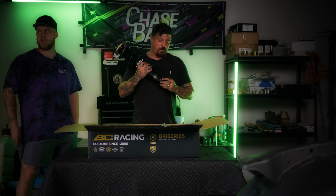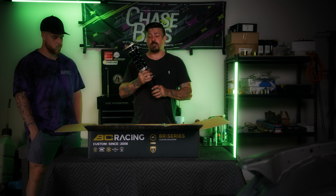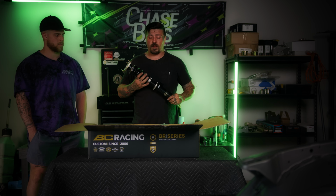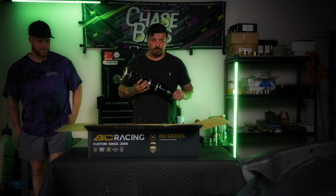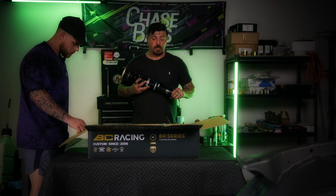I'm running a divorced coilover. These shocks were spec'd by Chelsea. He's helped me with all the suspension on every car I've ever owned. And he suggested an 18K front spring, a 10K rear in the bucket, which is kind of like a 5 or a 6K at the wheel. Very stiff. We're also gonna run a really stiff sway bar.